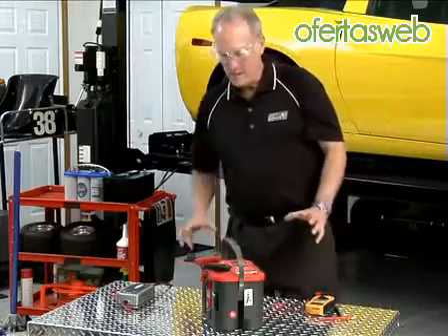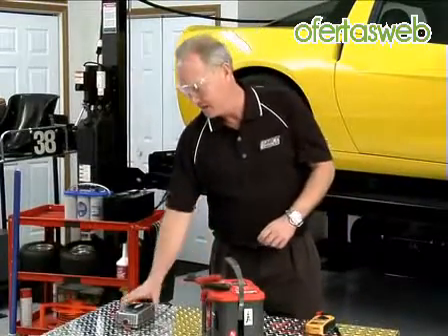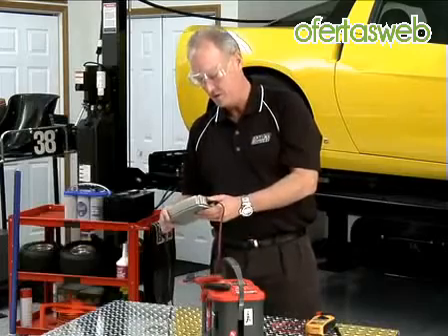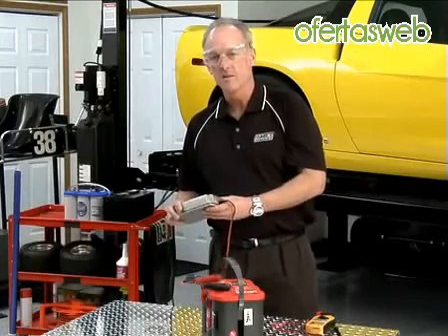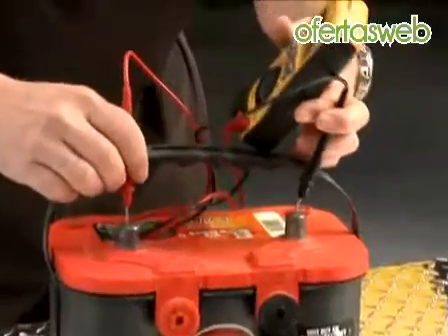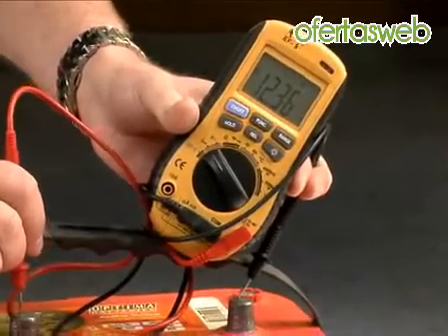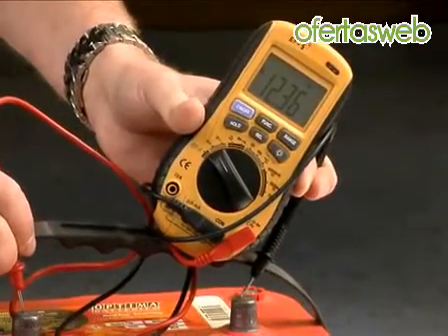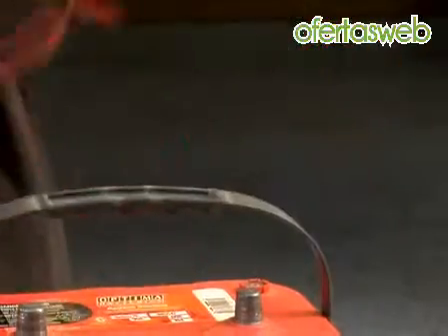This charger has been on for about 5 hours and it's not fully charged yet, but it should have enough charge to show that it's got over 12 volts and is going to eventually be a good battery. And there it is — 12.36 volts. This battery is going to be just fine. It should be up to about 12.6 or 12.7 when you put it back in your car, but it's well on its way.